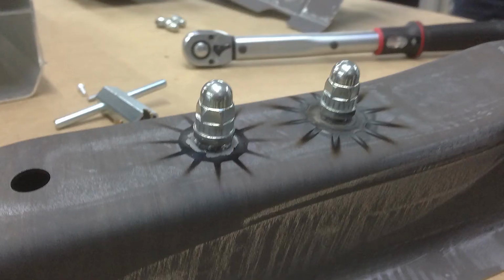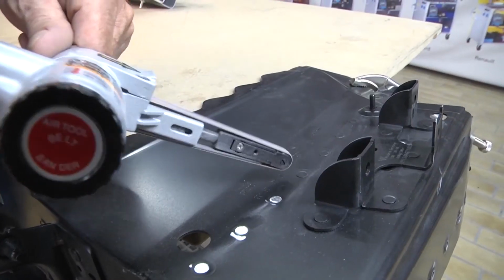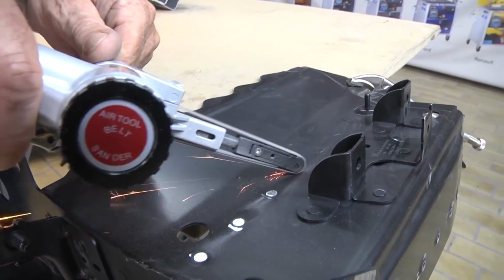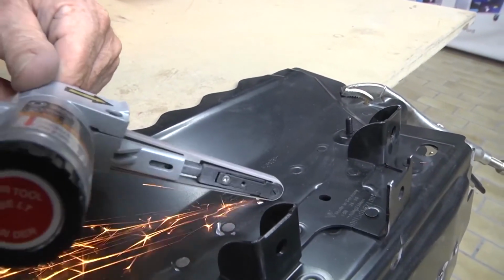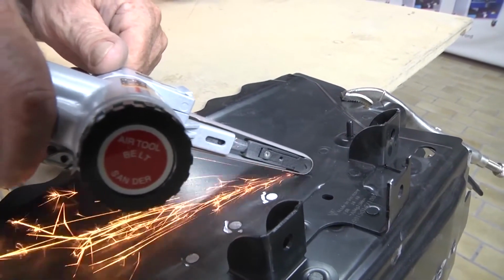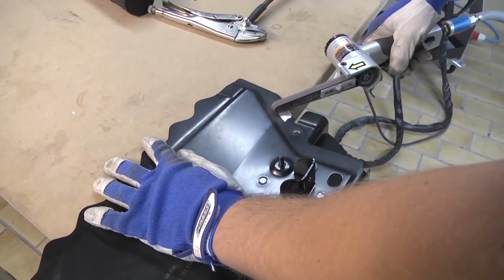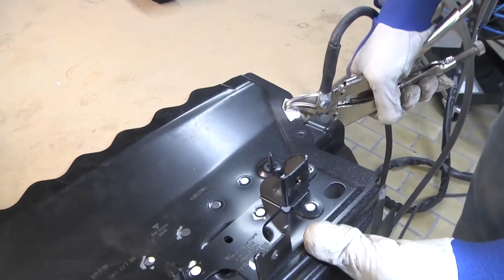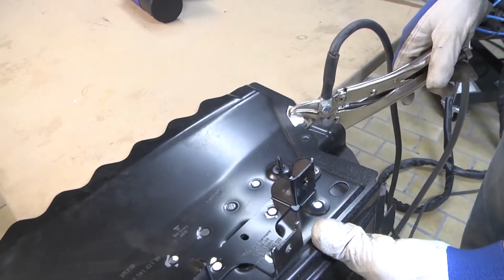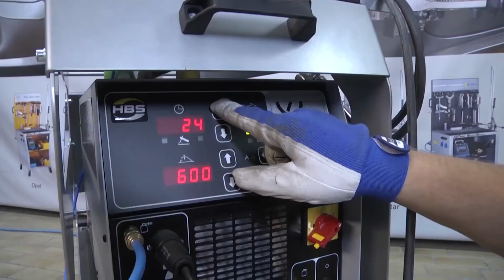We will now show you how to remove rivets quickly and non-destructively by using our Miracle AluRepairPlus system. First, sand down the paintwork on the rivet heads and remove dust from the surface. We can only ensure that the welding process will work properly if the surfaces are clean. Also sand down the place where you want to affix the ground.